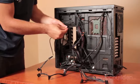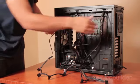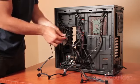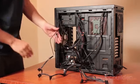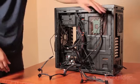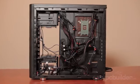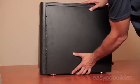As the fans supplied are only 3-pin fans, where your motherboard doesn't support the voltage control of the fans, they would run consistently at full speed within your case, which would have them running faster than necessary, reducing their life and creating unnecessary audible noise. Tidy and secure the routed cabling at the back of your case, and then install the opposite side panel back onto the case.